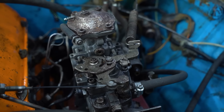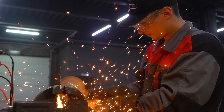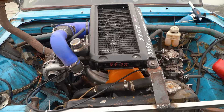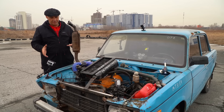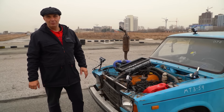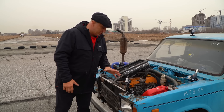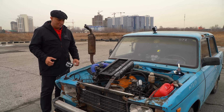Let's get back to work. Okay guys, we've made it out to the test track, we're looking good. We've already done a bit of fine-tuning. We did run into a slight issue — the high-pressure pump is chain-driven on this. At a certain point we realized we could really use an adjustable pulley, which would allow dialing things in more precisely. So we fitted one, did some fine-tuning, and now this runs pretty well with how we positioned it.